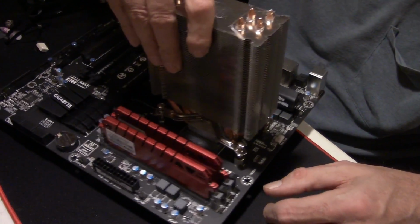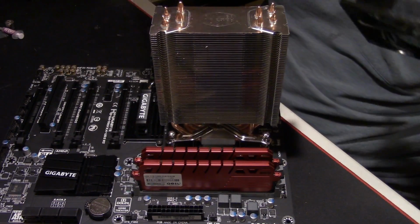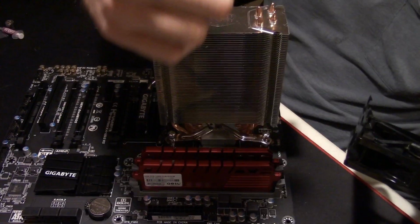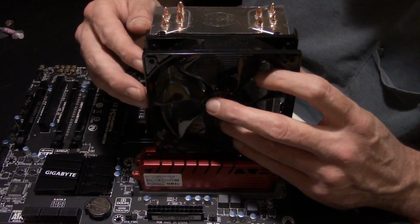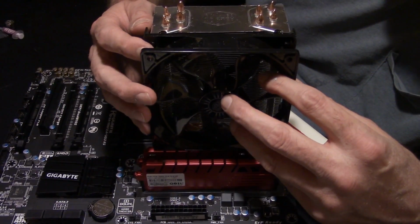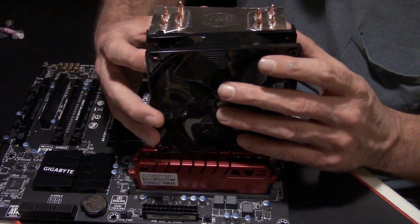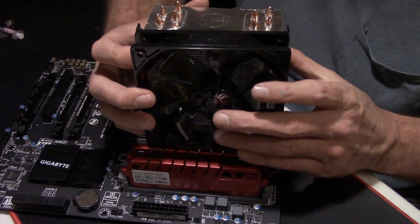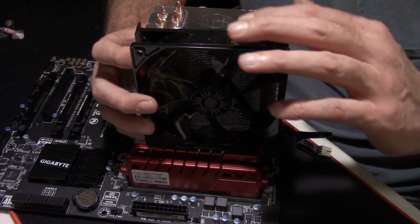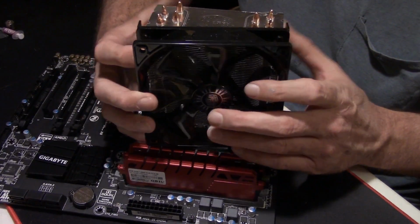Anytime possible, you want your fan to be in a push configuration, which means it's going to be blowing the air from your RAM back towards the back part of the case. I do have a little bit of a clearance issue though with my RAM. I figured it was going to clear smoothly, but it ain't. If the fan sticks up a little bit past the cooler, guys, it ain't that big of a deal. Like I said, it's pretty negligible.